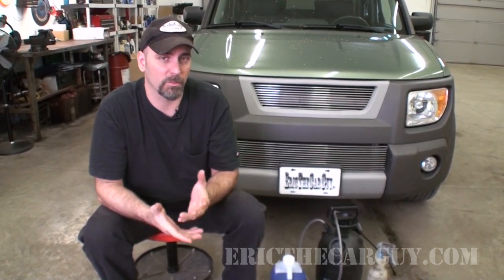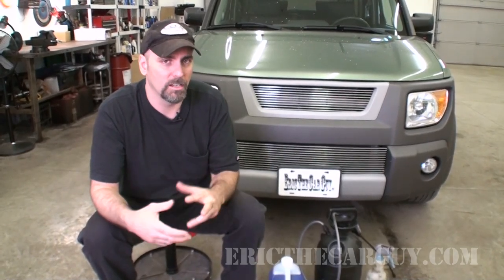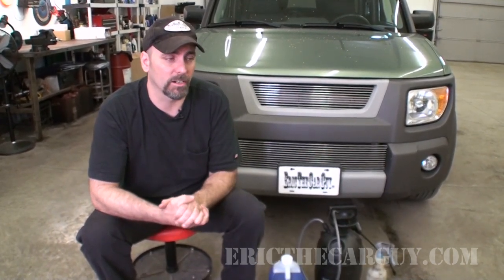One of the things Paul asked me was, 'Have you ever cleaned a condenser?' I said no. He says you might be surprised at the kind of stuff that comes out, and it does help increase the efficiency of the system. He says one of the biggest failures within the AC system is increased head pressures, which cause increased temperatures in the system. Basically, it's a heat exchanger — it takes the heat from inside the car and brings it outside to this thing in front of the radiator called the condenser. In order for that condenser to work efficiently, it has to be able to dissipate the heat put into it from the passenger compartment. Just like a radiator, it radiates that heat out into the atmosphere. If it's clogged, damaged, and doesn't have good airflow, it could decrease the overall efficiency of the AC system. So we're going to do a little experiment — clean it out and test the outlet temperature before and after, just to test the effectiveness of it.